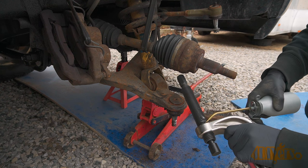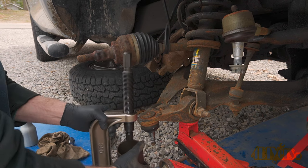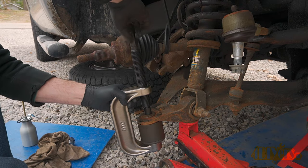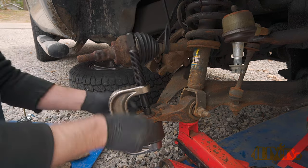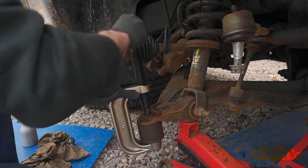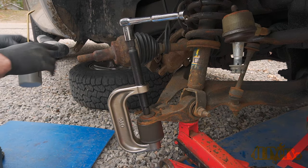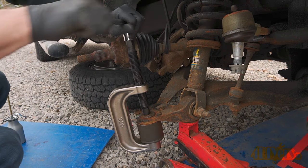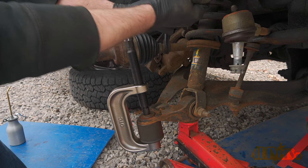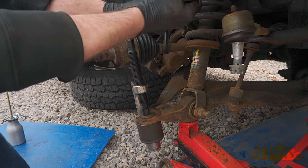Oil the threads of the ball joint press using a heavyweight gear oil — this will ensure there is no binding and you're not causing any damage to the threads of the press. The ball joint will have a lip on one side where it holds it into place; on the opposite side is where the snap ring is located. The snap ring side is where the ball joint is pushed from. There is a variety of ball joint presses available on the market, each coming with different attachments. The threaded rod will push down onto the ball joint, and on the other side will be a sleeve with a face plate where the ball joint has free movement. When the press is tightened, this will push down the ball joint, making it move into that sleeve.